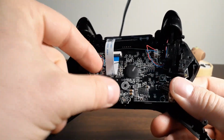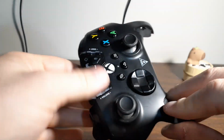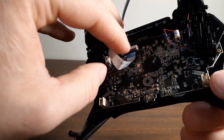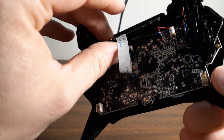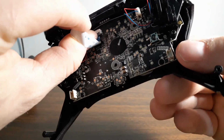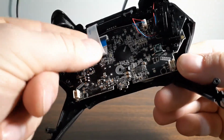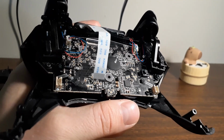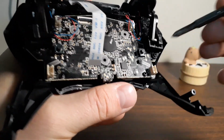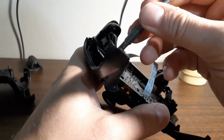So this ribbon cable is what connects this piece here with all of the audio to the motherboard. So you're just going to reach in past the ribbon cable and flip up this little black lever right there. And this tugs down. There are 4 Phillips head screws here, here, here, and then matching on the other side, there and there.